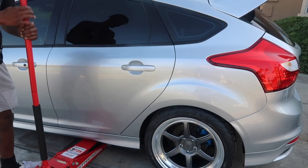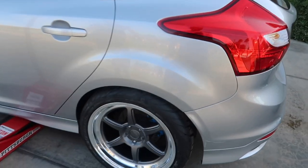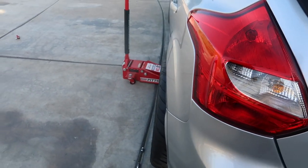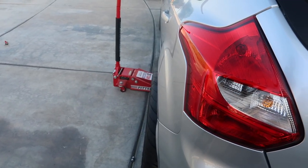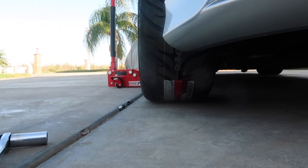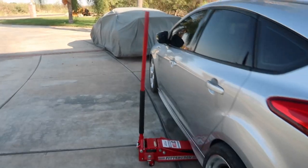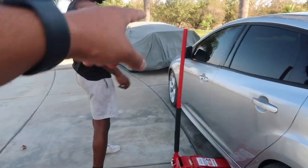Stop. Look, so that like he needs camber, right? Bro, it might be too much, to be honest. You're gonna go through tires. Look, this tire, I don't know if you guys could see that, but this tire's not that tilted right now. You should have probably done the front first, so we could adjust the camber at least. Like, at least we could play with it up there.